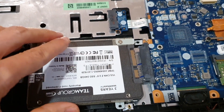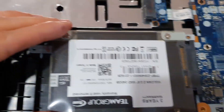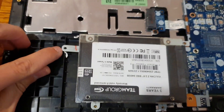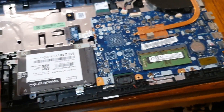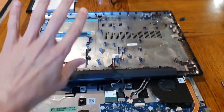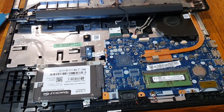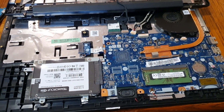With the bracket on the SSD, we align it and slot it in — just like the RAM, the SATA connector is not symmetrical so it's pretty obvious which way it goes. Push it in nice and secure, then pop the screws back in. With the RAM seated and the SSD installed, I'm going to place the back cover on and fire this up before putting all the screws back in — that way if there's a problem I don't have to fully disassemble it again.